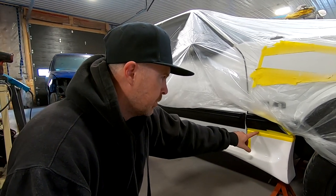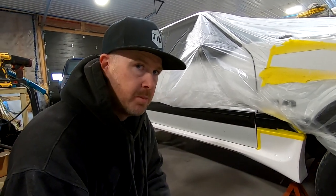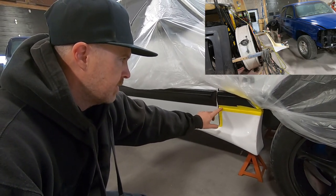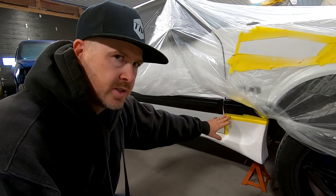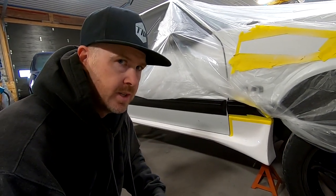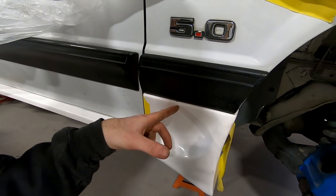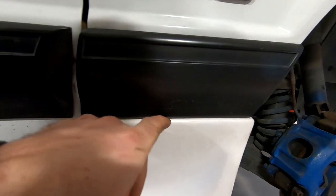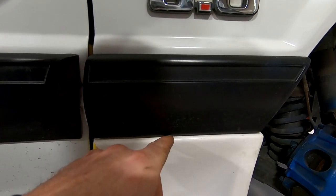From there we'll pull the skirts off, and then I will be fiberglassing in some of those custom little metal plates, similar to the ones I made for the rear bumper — doing the same thing here, fitting right underneath this back section of the molding trim. Just enough to keep this in place without having to rely on two-way tape, urethane, or any other adhesive. You can see here there's actually a little void in the fiberglass up here, so that is going to have to get fixed. Some of this needs to be shaved out just to make it not so thick underneath the molding.